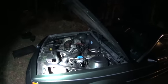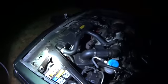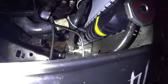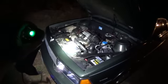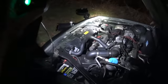It took me a couple hours — it's almost dark, moon's coming up — because I spent extra time cleaning everything. Here I got the new radiator in, as you can see, nice and shiny. Just fired up the engine, warmed everything up, made sure there's no leaks. Of course I spilled the coolant all over the place working in the dark, but that's okay. Anyways, this job can be done under an hour to replace the radiator — no major issues, especially nice to work with a car that has no corrosion. Everything comes off so easy.